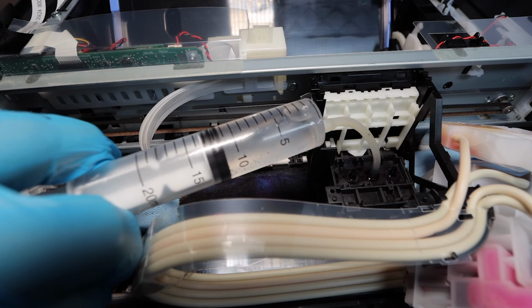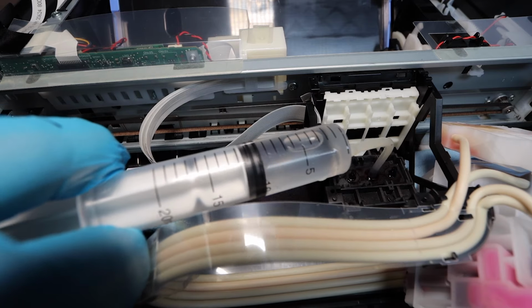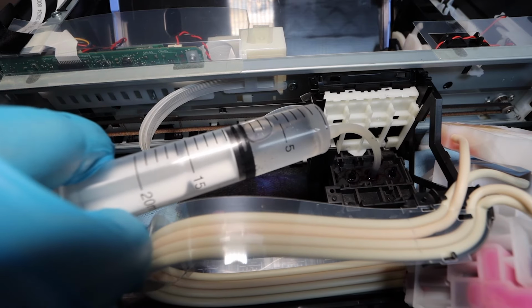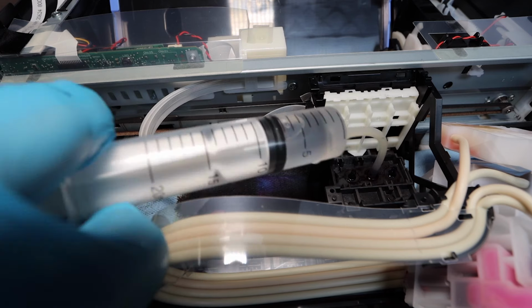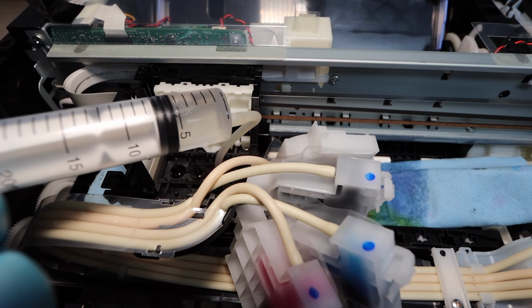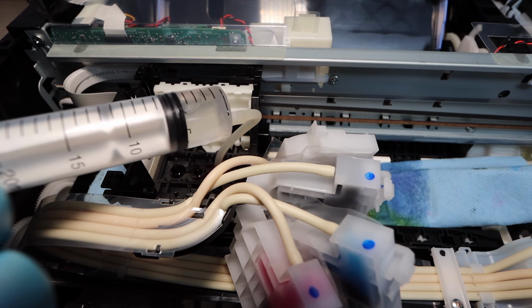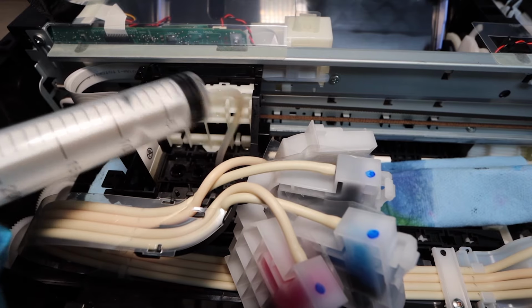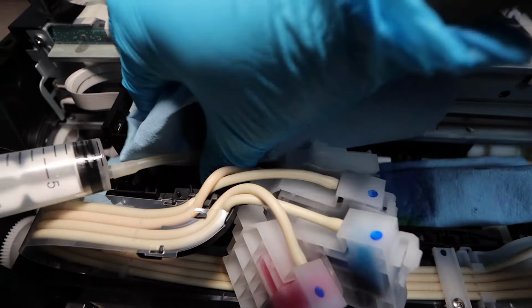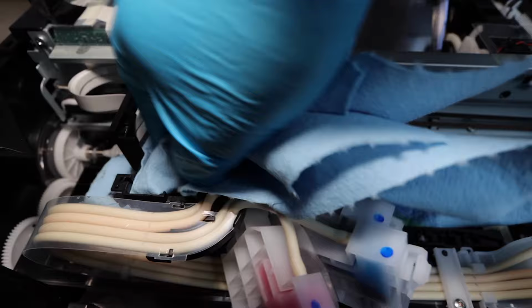Now, if you have a general problem, you are going to clean all of these nozzles, every single color, black, yellow, magenta, and cyan. You're going to clean all of them if it's a general issue. If it's a specific issue and just one color is not working, then just clean that one color and save the solution. But if it's a major issue, then you're going to want to, of course, clean all of them. Now, one really important note here is if you're having trouble pushing the solution through, you're going to need to warm up the solution. So there are a couple videos on my channel showing you how to do that. If not, they're on the website.